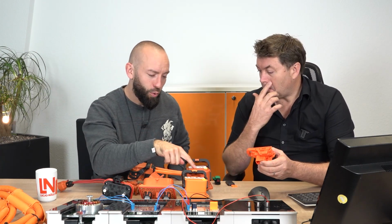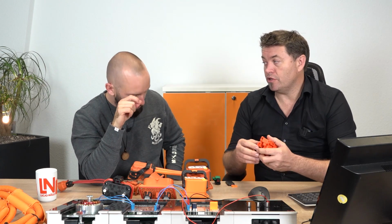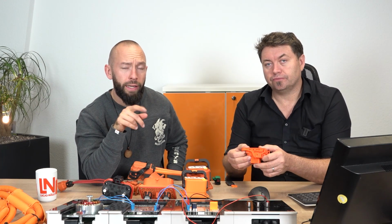When we're just looking at the amounts of current here, that would create a massive spark, I guess, huh? Exactly, and that's what you read everywhere about arc flash protection. There are some famous videos out there, and that's when a connection or a conductor is pulled apart while current is flowing through it. If it's high current, the current will want to continue flowing, and that's when you get an arc flash, and that's when you can really hurt yourself. You find a couple of videos on YouTube, so just Google for that, but also in our car train courses we have pretty cool videos showing what can happen.